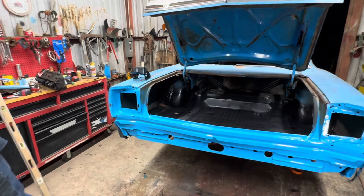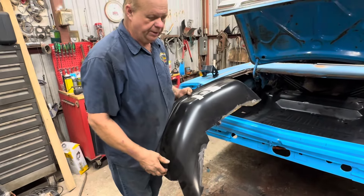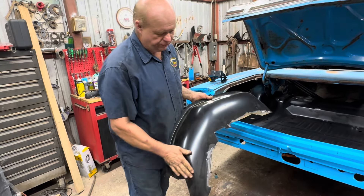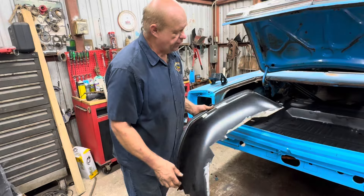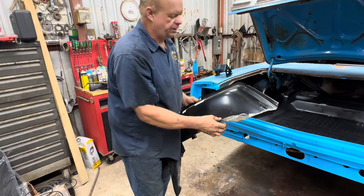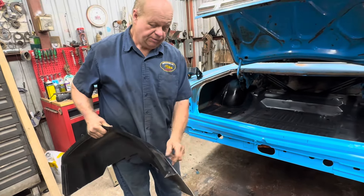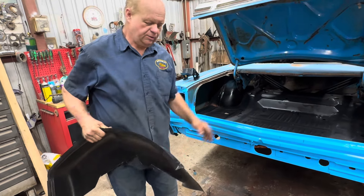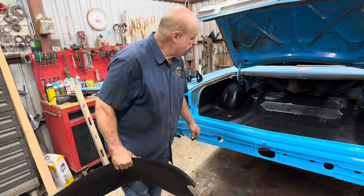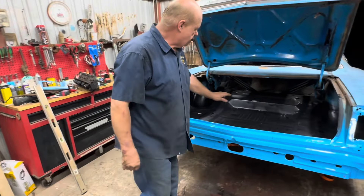What I've done for the wheelhouses is I bought two of the inner wheelhouse pieces from AMD — about a hundred dollars a piece. That's a lot of money, but I thought about trying to bend that metal and all that, and I thought, shoot, I'll just go buy two of these. I just cut my patches out, cut the pieces out, and I laid them out on these new pieces and marked them, and they fit really nice. On the outer wheelhouse, I just used the piece off the back side of the inner ones. Actually it matched up really nice and I didn't even have to buy those because I just needed a small piece right here. I had to bend it just a little bit, tweak it, but as you can see they fit really nice. That was an easy way of doing that without having to replace the whole thing. Got it welded in nice and solid, ain't going nowhere.